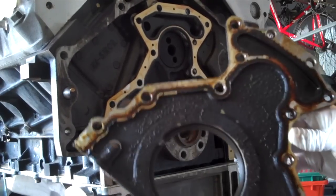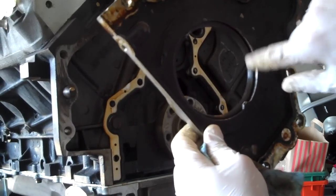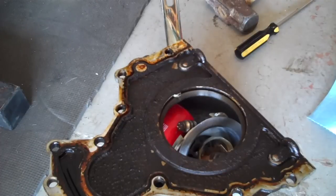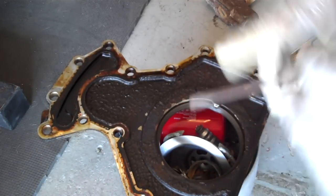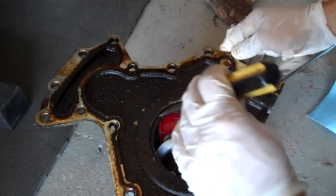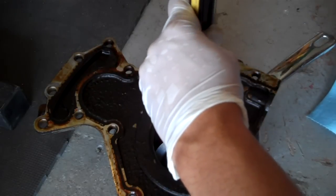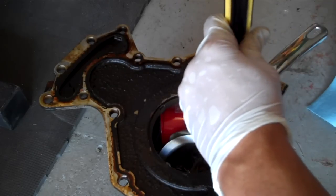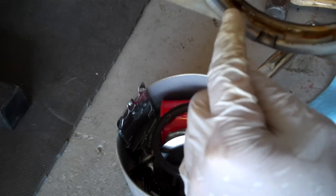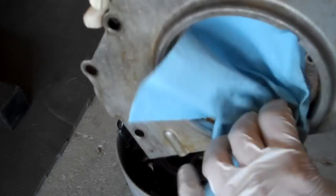Alright, the next thing you need to do is pop the old gasket out of here. This is going to be as simple as just taking a screwdriver and a little hammer and just kind of popping it out. Take a flat-bladed screwdriver, place it just on the edge of the seal, making sure not to push it in a direction that may mar up this cover — otherwise you won't get a good seal. Just kind of tap it out; it's probably going to break a little bit, but make your way around giving it a few taps and it should just come right out. This surface here you definitely want to make sure you're not damaging in any way as you're removing that old seal, as you will not get a good seal with the new seal if you've damaged that area.